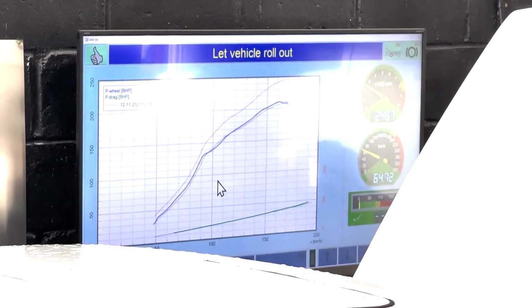We are done. Basically we're seeing very high intake temps, getting into the 60s at the end of the run. We're hitting 1.1 bar peak, tapering off to 0.9, running slightly richer fuel, like 11.8 at the red line. It's suspected that the cause of the issue is a pipe between the turbo and the intercooler. The customer's indicated it's not very big anyway. It's like an inch and a half in diameter, and then it's been pushed into shape to kind of fit where it's got to go.